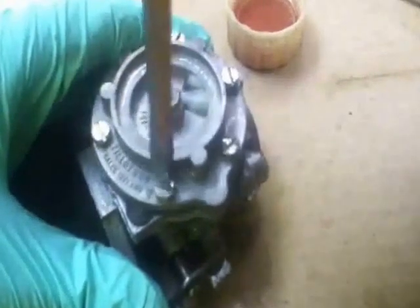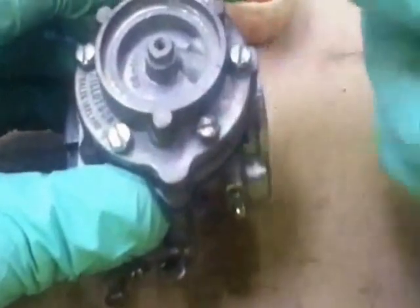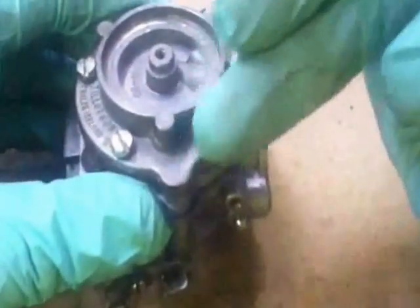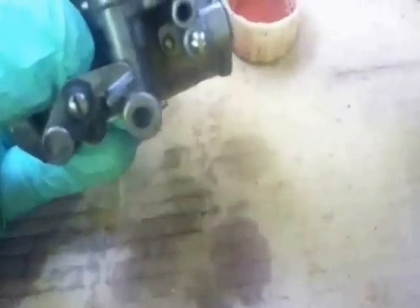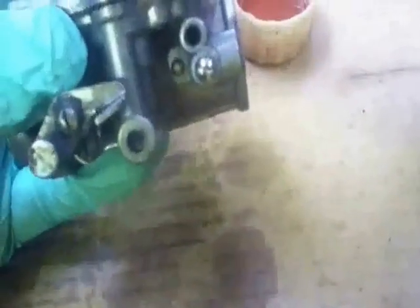The reason being is you want this whole plate to tighten down as evenly as possible. You don't want one side to be more tight than the other whilst you're tightening the other side. Because it could damage things, and what you want is a perfect seal between these diaphragms, gaskets and plates. So the last thing you want is for one side to be really tight and the other side damaged because it hasn't been tightened evenly.